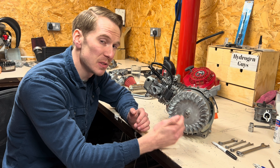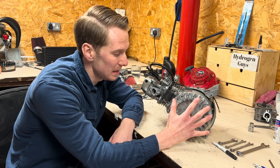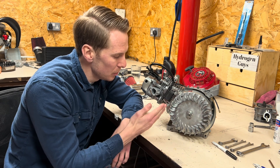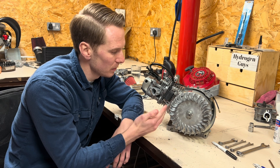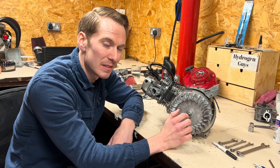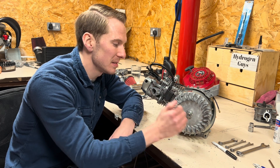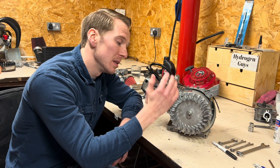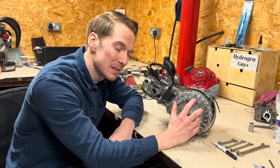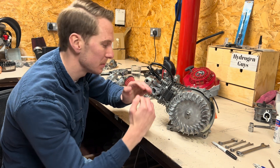You need to set the ignition to top dead centre, and that's what I've done here with this engine. Since the last video I've now added the aluminium lightweight flywheel which is capable of 10,000 rpm, and I've moved the coil up using a bracket. By moving the coil up in this direction around the circumference of the flywheel we're actually retarding the ignition timing. The standard ignition timing on this engine is something around 30 degrees. It's now set to 3 degrees past top dead centre. I'm going to be extra safe and have it set to 3 degrees after top dead centre to allow for that piston to rock over before it starts pushing back down before the ignition goes off.